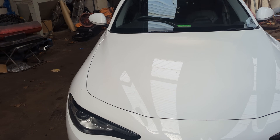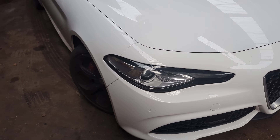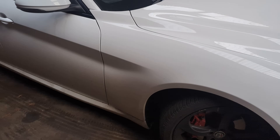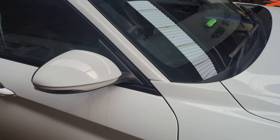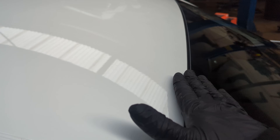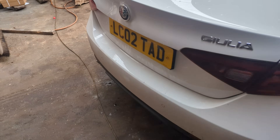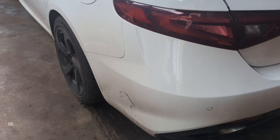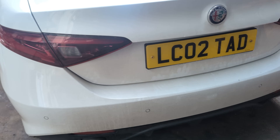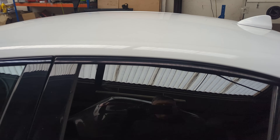Let's start by checking out the outside of the car — not looking for dinks and dents, all I'm looking for is how the bodywork is holding up. There are no signs of lacquer peel. The front bumper colour on this white car is still a good match. As most of the car is aluminium, you're not going to find any rust on the body panels. The wing mirror colour is still matching well. The usual spot for rust is around the windscreen on older Alfas, but that is all fine. The rear bumper colour is a good match, body panel fitment is still good, there's no water ingress in any of the rear lights, and the exhaust tailpipes still have a shine to them.